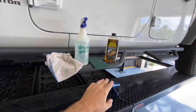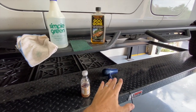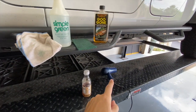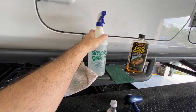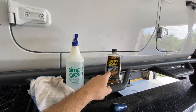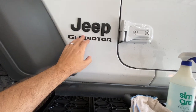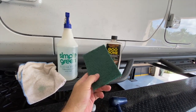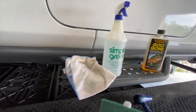So what do I use? A hairdryer to heat this up just a little bit. I would recommend a hairdryer versus a heat gun because the heat gun just gets too hot — why risk damaging your paint when a hairdryer will work just as well? Then a little bit of — it's actually just water with about six drops of soap in it just to clean it up when I'm done. And that's because I'll use Goo Gone — I always want to call it Goo Be Gone — just to get whatever leftover adhesive might be there. And then of course the coarsest Scotch-Brite pad... I'm kidding. Do not use one of these. Do not scratch your paint with one of these. Let's get rid of that before I'm tempted.